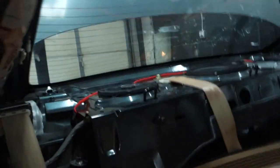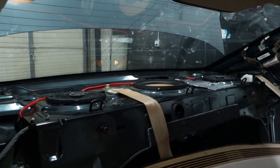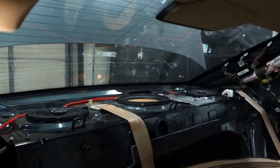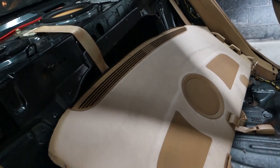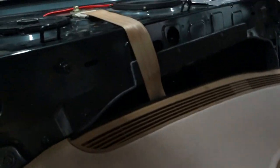It's not a loss because we're also going to be rerouting where he's getting the signal from. We'll actually remove the factory sub because we have an RCA source now up front from the radio — when Best Buy's system was put in, the factory radio was still in. I'm going to disconnect the factory sub, leave it disconnected, and undo that red wire in the back. Also: you don't have to fully remove the rear deck to work — you can just lay it like this and work over it. Now you have access to the rear deck.